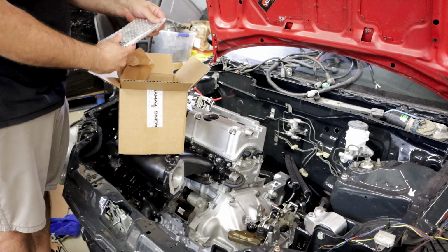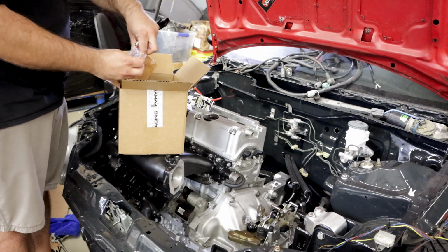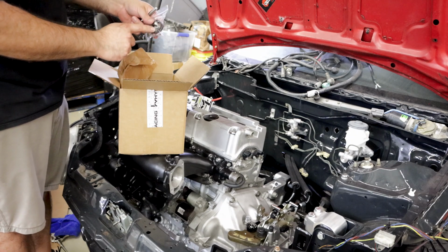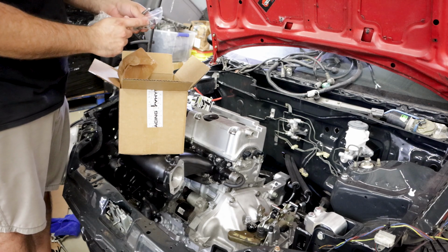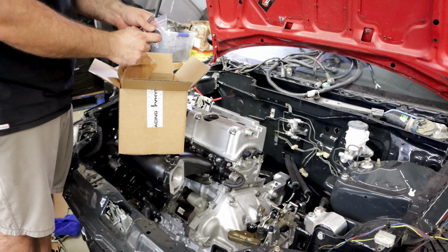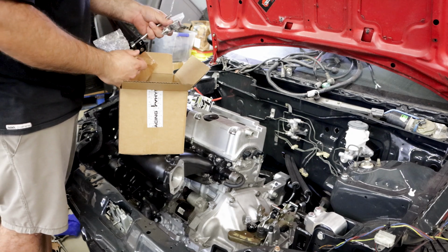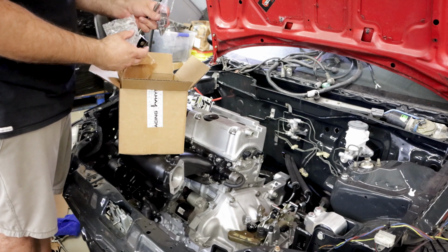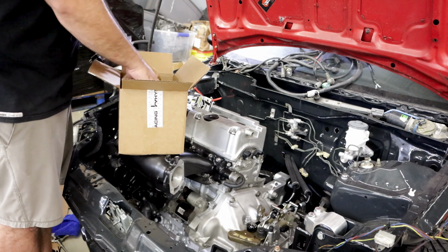And the box. This is the shifter offset that comes with every shifter. And in here we've got mounting hardware, stainless bolts and washers. And this is the hard spring. We consider it the hard spring, but it's actually softer than the one that's in the shifter. So if you want less resistance, less force or feedback, you can take the top of the shifter off, swap this thing out and use this.